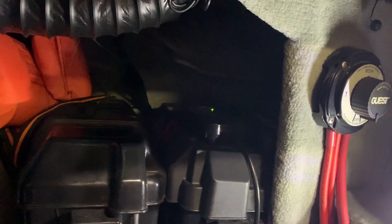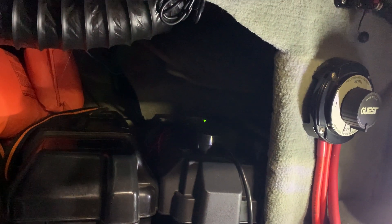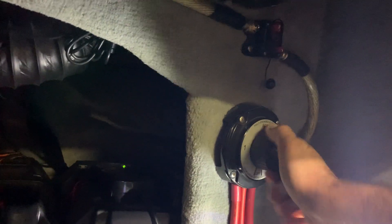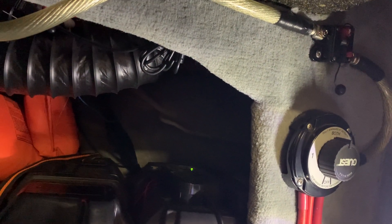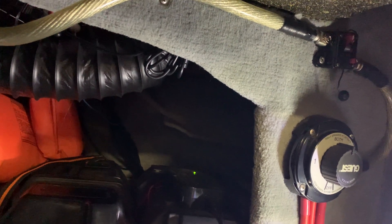In a nutshell, I usually leave the switch on both. I have a couple of Harbor Freight trickle chargers hooked up to keep them from slowly draining over the winter or when sitting for a few weeks during summer. You can run one, both, or just two — I just leave it on both all the time. We don't sit in the cove and jam out for five hours at a time, maybe an hour here and there. I've never had trouble with the boat starting up again, but I always carry jumper cables just in case.